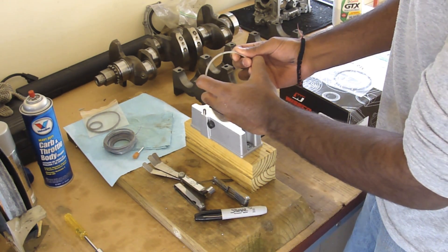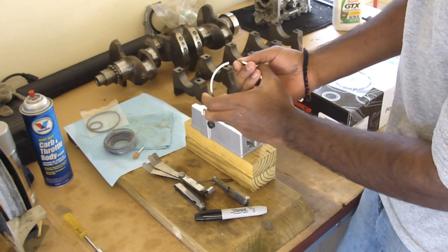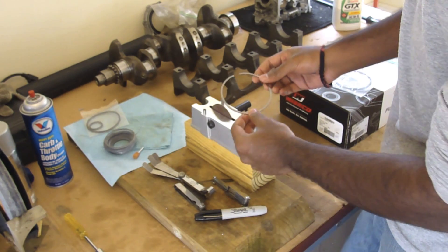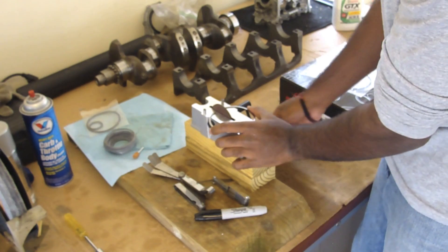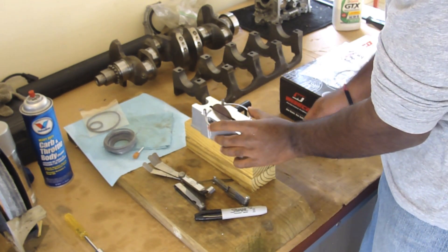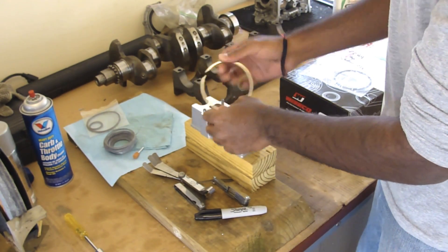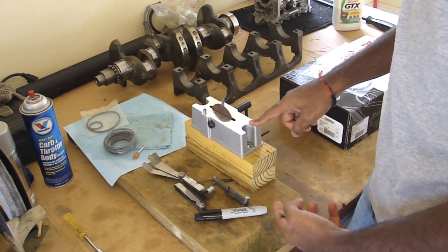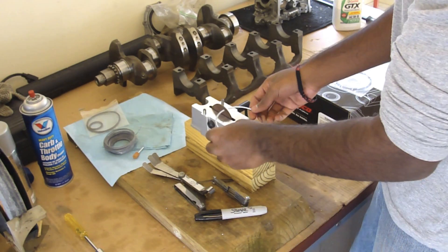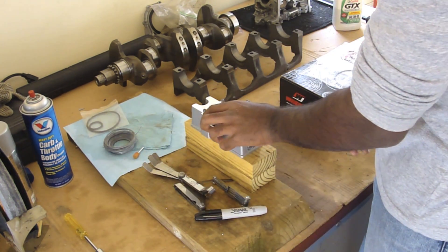It's not going to be completely flush. The gap doesn't really close all the way up, but if the inside of your gap is smaller than the outside of your gap, the inside is going to butt before the outside and you don't have an accurate gap measurement. So when you're putting this in here, if you're just randomly filing and the ring is not straight, you're going to have an uneven gap. What this filer does is it has these two pegs, and when you put your ring in there it's automatically straight — so you know everything is squared up and when you're grinding it, you know that the gap is going to be straight. That's why I like the Summit Racing Piston Ring Filer. I got one from Speedway Motors which is the other one I was talking about — it does have the pegs but they're a lot closer together so you can still kind of mess up, especially if you're doing it for the first time. This one makes it a lot easier to get everything squared up.